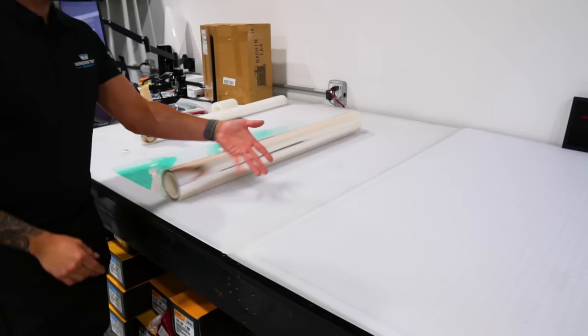We heat up this area where the rope is, and I'll get this to lay down. So instead of pulling the rope right now, which would cause the tint to rip off the window, I'm gonna lay this under the rope carefully without creasing it, heating the window up, then I can carefully tug the rope and lift up along the tool.